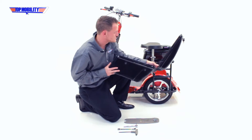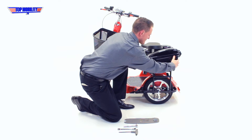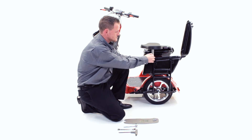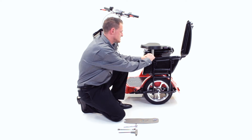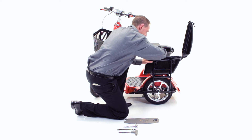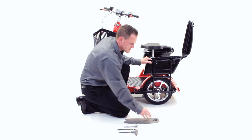Take the other end and plug it in. We're going to repeat this step for all four of these. Once all grommets are installed, it is now time to mount your saddlebag to the mounting bracket. You're simply going to lay it on top of your mounting bracket and you'll see how all of these match up. You're going to take your bolt — you've got two washers — lay the smaller one on first and then the big one on last, and simply insert it and tighten it into the welded nuts on the main bracket. You're going to repeat this with all four.